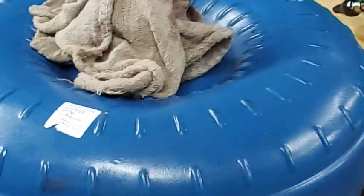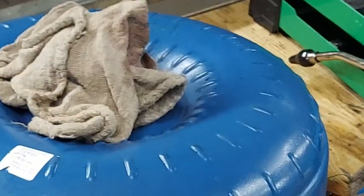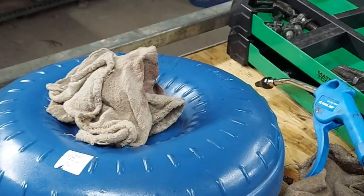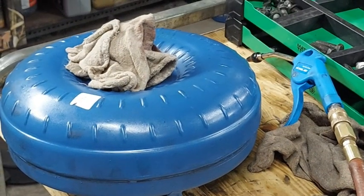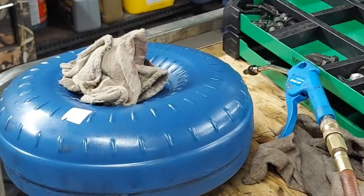It is a little porous right in there — not so much here or over here, but right here. If you put that in and run it without noticing, that'll ruin your evening. So stuff your rag on there, put your air checker on it, and make sure your converter is sealed up — because it's pretty deep, especially in a four-by-four, if you get the whole thing in and then find out it's leaking. Just a quick tip when you're doing old trans work.